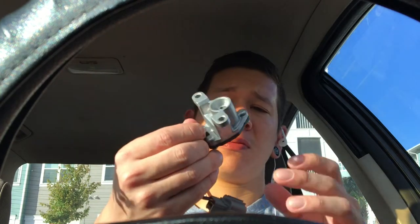A couple of things about the transmission speed sensor: your speedometer will stop working, your odometer that counts the miles will stop working, and the trip miles counter will stop working. Another symptom is late shifting — it'll shift late going from first to second and kind of jerk before it shifts. A lot of people would say it's the transmission, but it could just be this sensor. It goes on the transmission and counts the velocity so the ECU and TCU know when to shift.